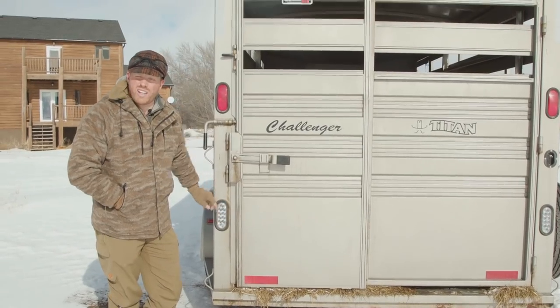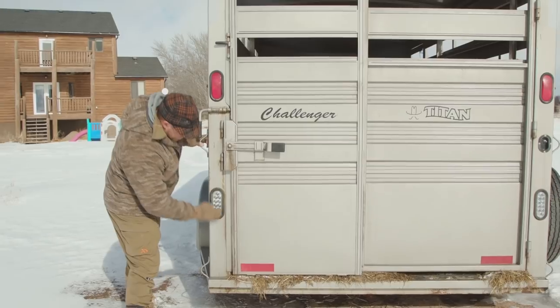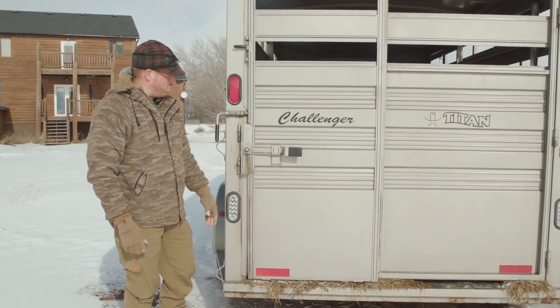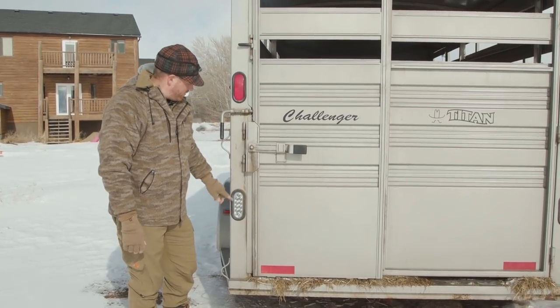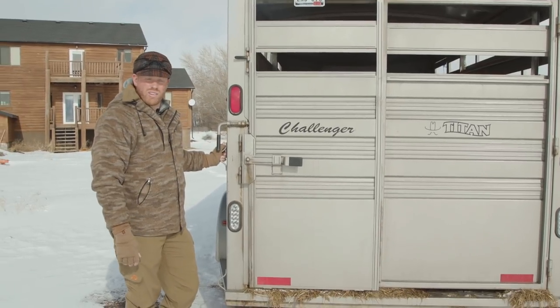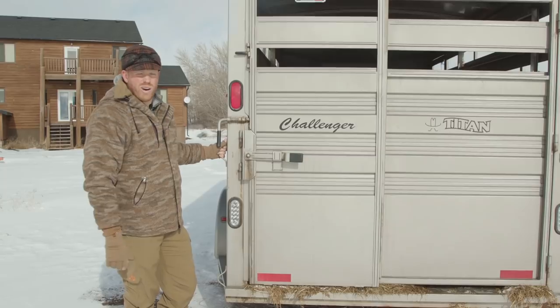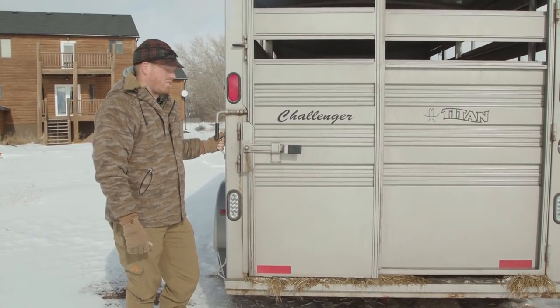We went and put LED backup lights on this one too. It's a little bit bigger and the frame to put the lights on is a little bit bigger, so we're able to put longer, taller, more lumen lights. You can do it yourself - cut the hole, put it in, run your wires to your power source, ground it, and away you go. Or you can have someone do it. If you live in Idaho, I highly recommend Mr. Driveline out of Melba, Idaho - his name is Levi, and the guy knows how to fix and do anything.